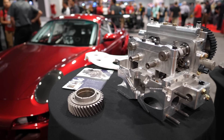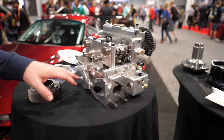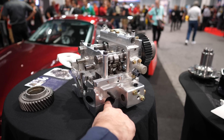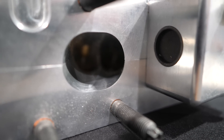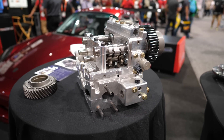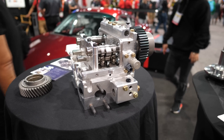I know that the stock Supra cylinder head — all the exhaust ports were like different shapes. Yes, correct. Is that like this too, or are they all the same? On this prototype it is, but it turned out that it was very difficult to machine. If you look into this port, you can see it going all the way to the valve. CNC-ing that was really difficult. So with the final design, we will have straight exhaust ports, which are a lot easier to machine, and it will flow a lot better too. The only downside is that you need a different exhaust manifold.